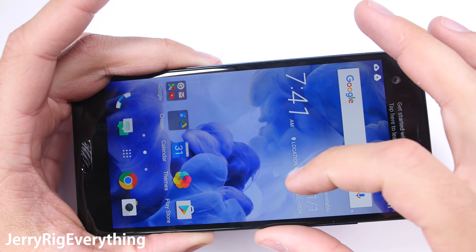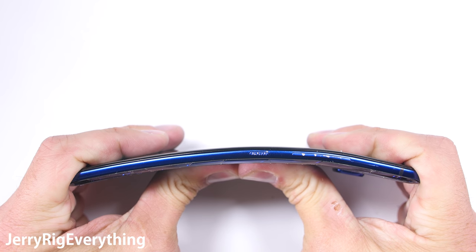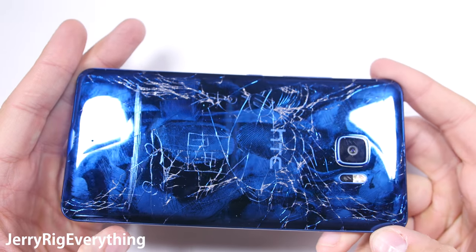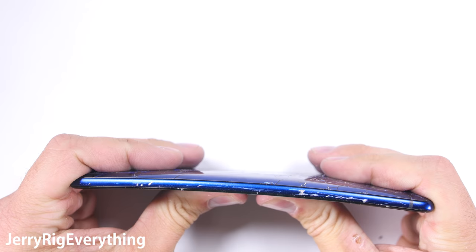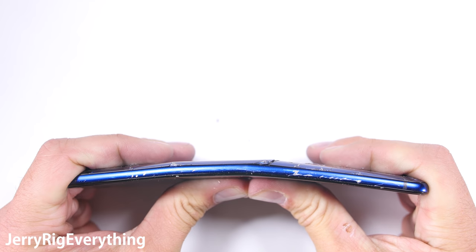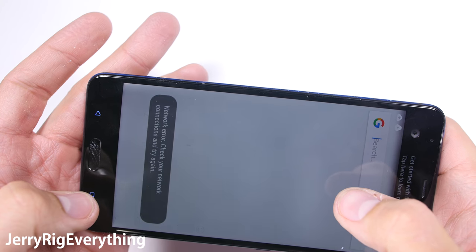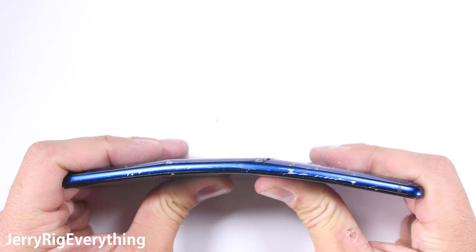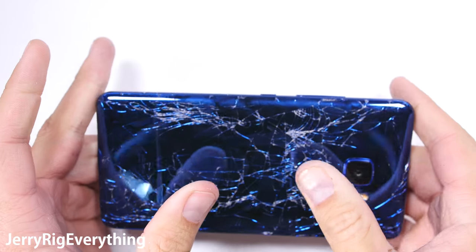And now the bend test. Remember, the HTC 10 was the winner of my smartphone durability award last year. I can tell right away though that the Ultra is not going to follow that same rigid path — it has more in common with the soft iPhone 6s. It's important to note that the back glass is only cracking because I directly introduced flaws by scoring it with my level 9 pick. The glass on the HTC U does not contribute to the structural integrity of the device — it rests on top of the frame, unlike the Galaxy S7 where the back glass sits inside the metal frame, helping make the phone more rigid. So while this phone survives the bend test overall, it still flexes like a soggy Twinkie and will not be in the running for the 2017 durability awards.